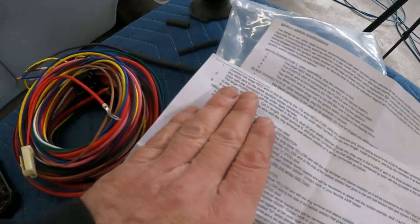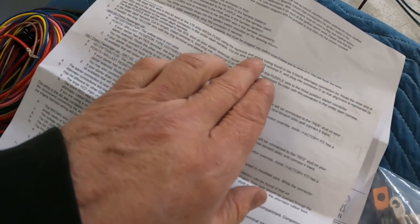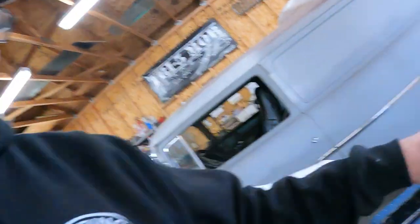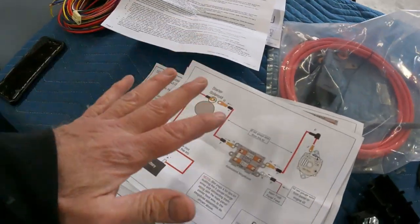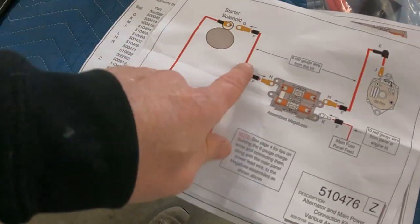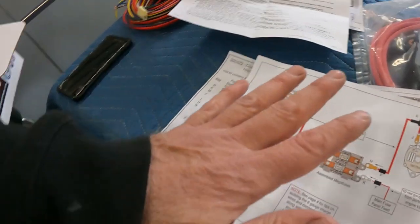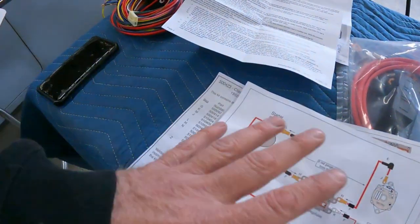This is the underhood one. First thing you do is connect the large red wire in this kit to the 175 amp mega fuse using the terminals and alternator connection kit — well, that's kit Z, the last one you install. So you have to skip from this one to get to the last one. I opened up Z which has these big fuses. So you have battery to the starter and then you put these big fuses in line. I'm doing a trunk-mounted battery and I've got to have a kill switch for NHRA. So I can't really just follow what they're doing here — as usual, I got to make it harder.